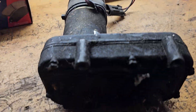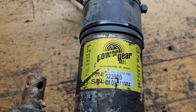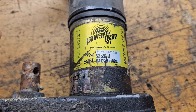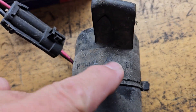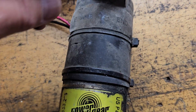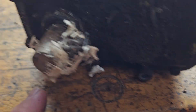Now, the number one reason why slides mess up is we overload them — we'll talk about that another time. Right here is a Power Gear motor, a good one. One of my members wanted to change one that was broken and swap the other out too. This is the brake, and this is how you disengage it and manually bring it in.